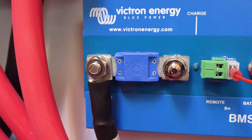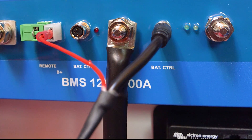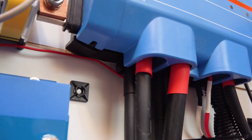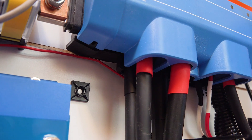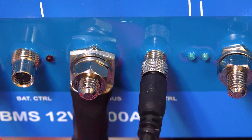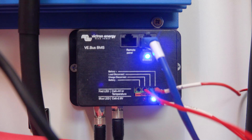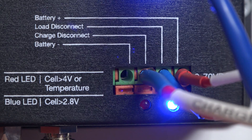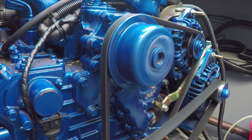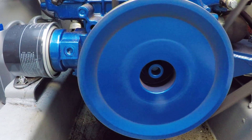The negative from the engine bay connects to the far left terminal of the BMS 12200. It goes via the fuse, and there is a short length of 50mm cable from the middle post to the negative of the lithium bus bar. The alternator cable connects to both the spade connection on the BMS 12200 and a three pin plug. The BMS 12200 requires a constant positive and switched positive feed from the main lithium battery management system. If you suddenly cut the load whilst an alternator is running — for example if the batteries were full — it can damage the alternator.